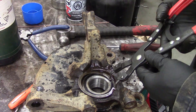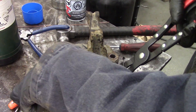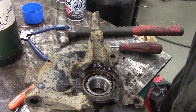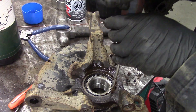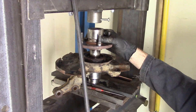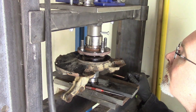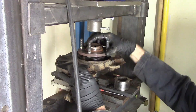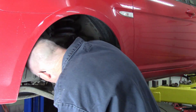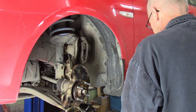If you like this hydraulic press, there's a link to a set of free plans in the description below — help yourself. It's arguably cheaper just to buy one. These are from KD Tools — I don't remember where I got them or what the part number is, leave a comment if it intrigues you. Then just snap the snap ring into the groove and then gently press the hub back into the bearing. I like to use a little bit of oil or any kind of lubricant to make it press in nice and neat. Then we stick it back on the ball joint bracket with two little bolts.